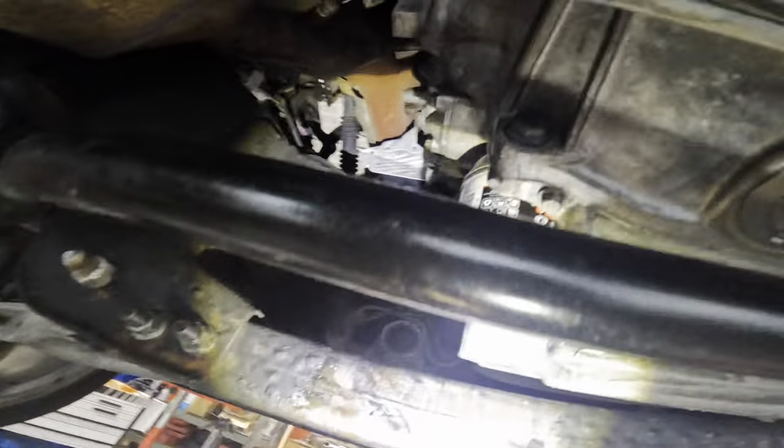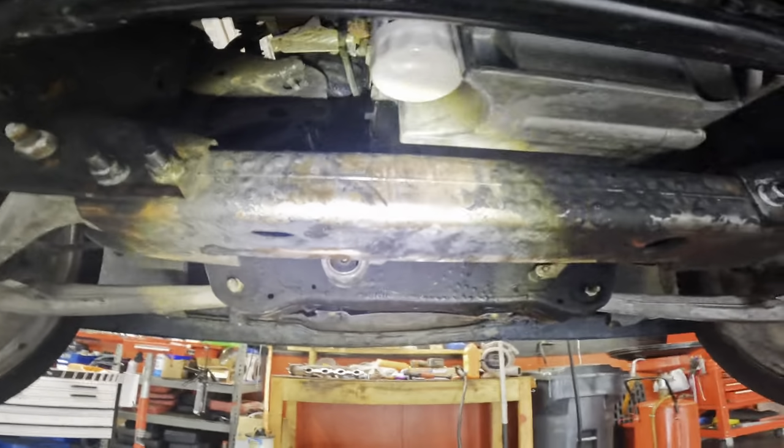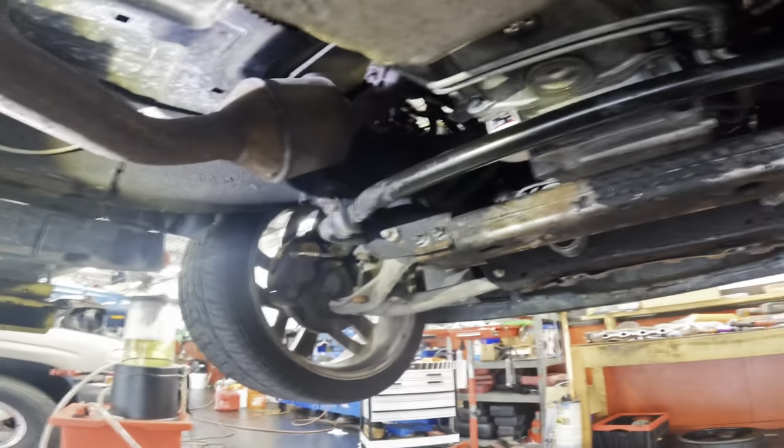That rattle noise is gone because I had to adjust this little plastic cover that was here. It was touching the, what you call them, brain fart. Torque converter bolts, there we go, that's the one. It was touching the torque converter bolts, so I had to take it loose and move it again. That being said, I think we are all good to go on this one. I need to let it come up to temp one more time and just make sure the coolant's topped off. So I'm gonna go ahead and close this out right now to save us all a little bit of time.